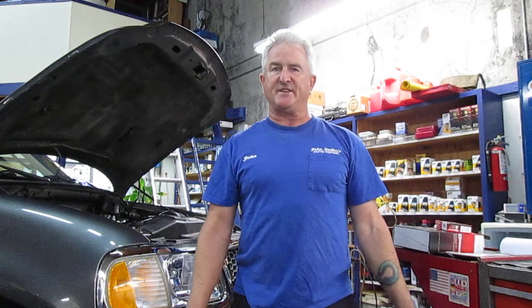It's one of those things you have to be very careful about — you kind of pay for what you get. There was also a bolt missing that goes from the bell housing to the motor. The drain plug where you fill the transmission fluid is a little bit wet at the bottom and the fluid looks old. We're going to fix the problem for him — put in new spark plugs and new spark plug wires, clear the codes, and test drive it to make sure it runs good.